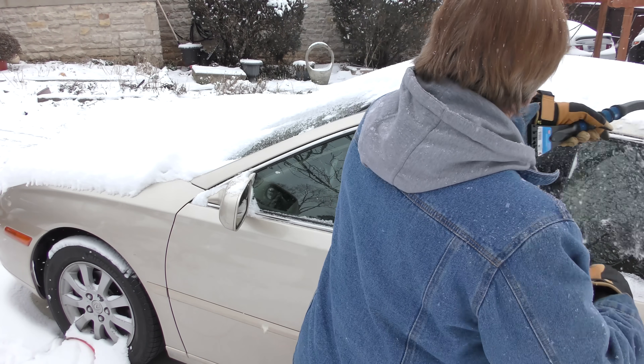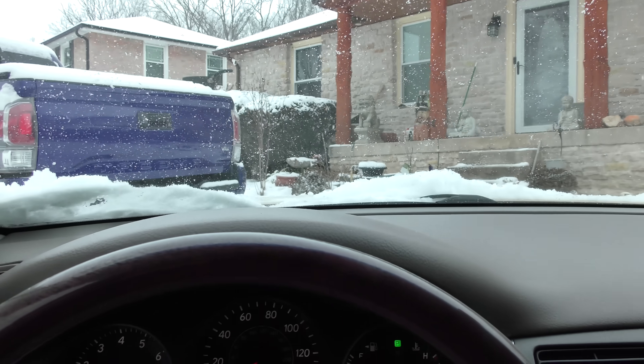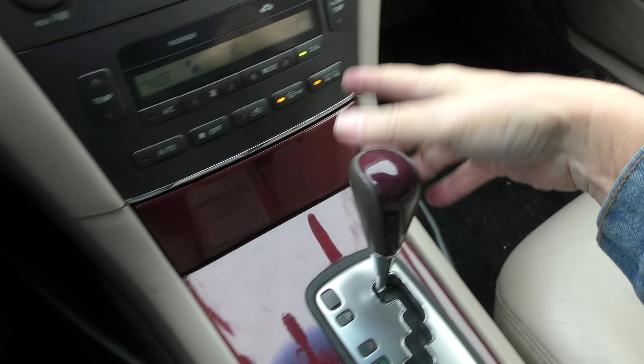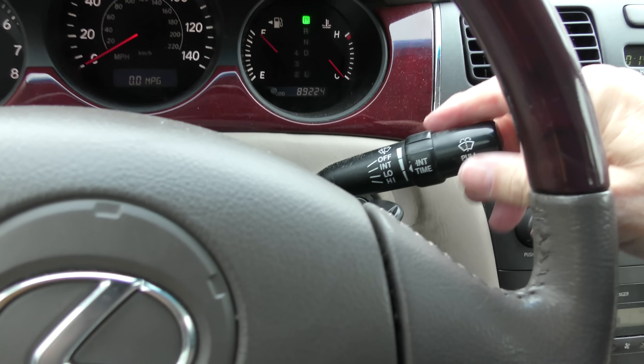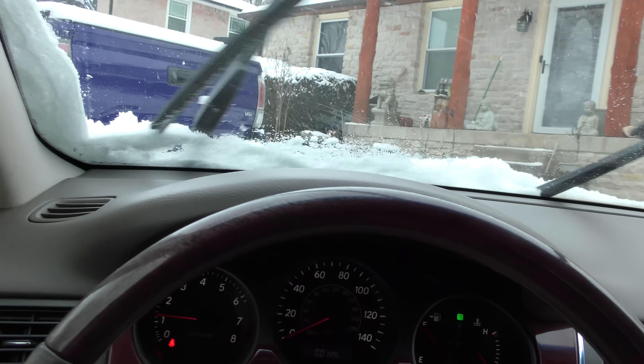Here's a tip: wait until you have your windshield all cleared and melt it out using the defrost, before you turn the wipers on. Now it's nice and clear so you can see — they work fine. Because if they're frozen onto your windshield and you turn on your wipers, you can end up burning out the motor or stripping the gears. Make sure the wiper blades are clear and not iced in before you ever turn them on.